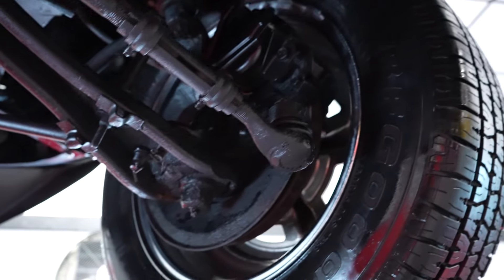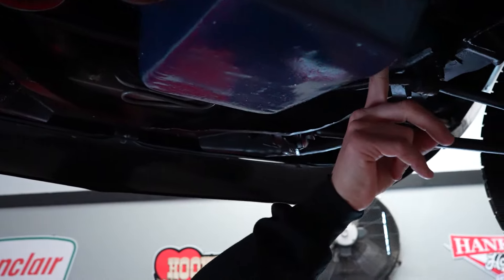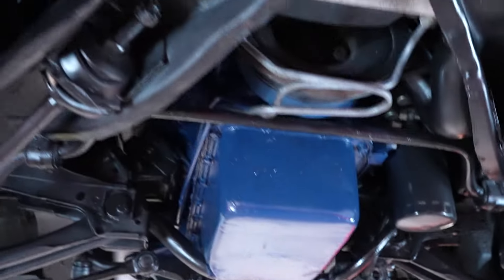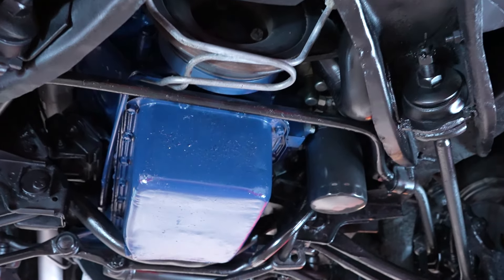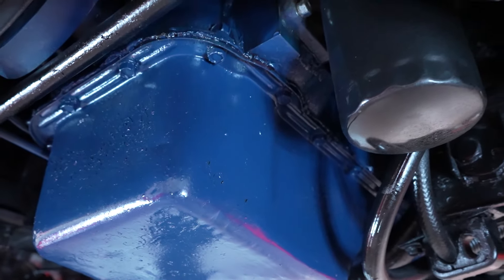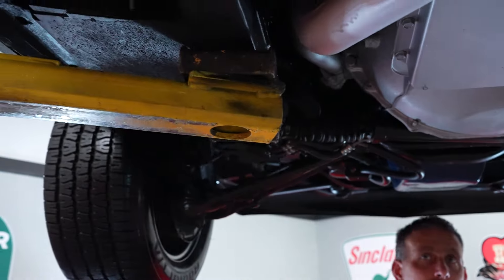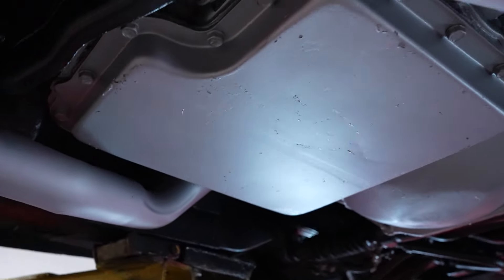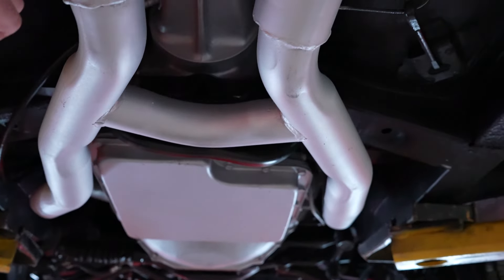Let's put it in the air and check out the underneath of our absolutely magnificent 1969 Ford Mustang 390 car. Disc brakes up front. The bottom of the 390 looks dry at this time. You can get a good view of the front of the pan from the passenger and driver's sides — everything looks nice and dry. Frame rails on the car look good — torque boxes and frame rails, driver's side and passenger side. The tranny pan is nice and dry. Let's look at your tail shaft seal — that's dry. The e-brake is hooked up and does work.